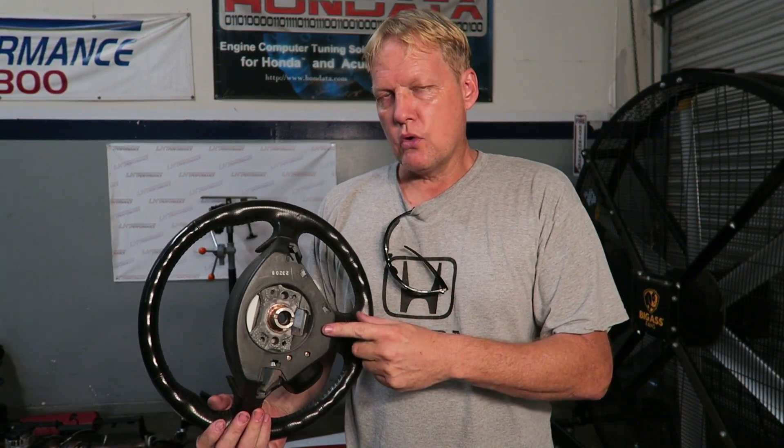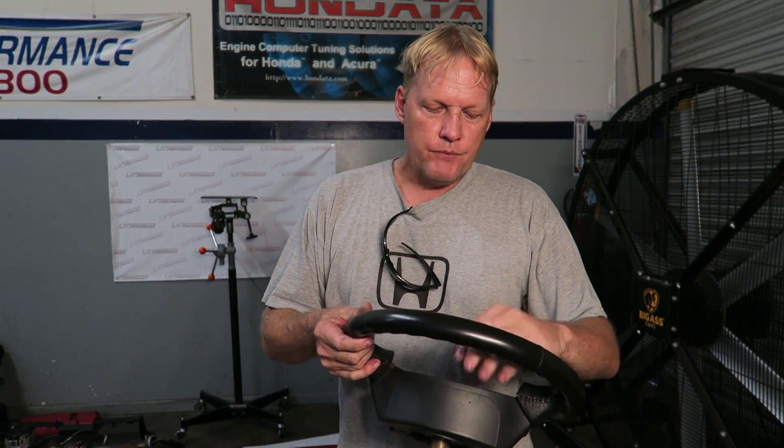Two scenarios — usually it's the torque angle sensor, also called the steering angle sensor. The other potential culprit is the power steering control box mounted near the battery — that gold box with the four bolts and the big plugs. Brand new it's something ridiculous like $400, but every junkyard has them for about $50 to $60. One junkyard I know that can help is TAE over in Plant City — check those guys out. That's one of the first things I'd change because it's cheap. When fixing a problem, always throw cheap parts at it first — if it fixes it, great; if not, you're not out as much. So check the power steering control box first, and if that doesn't fix it, you'll have to do the angle sensor.